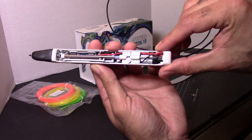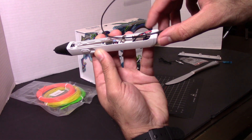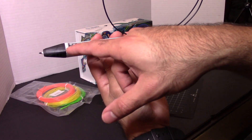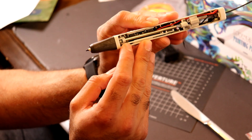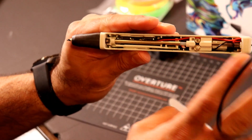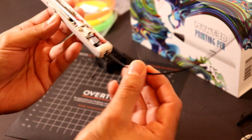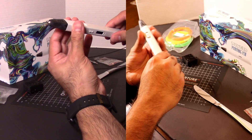So there's the inside of the pen. You've got your little motor here, the little extruder mechanism to pull the filament through, and your power cables. You need to be really careful when you pry the back off so you don't slice the cables. There's a little metal nozzle — to replace the head it's just a small Phillips screwdriver and the entire head pops off. You can get a new head on Amazon or through the manufacturer's website. There's the feeder, the tube where the filament goes in, and the circuit board for the OLEDs. When troubleshooting, you're basically just replacing the head. It just snaps right back in like that.